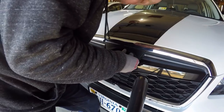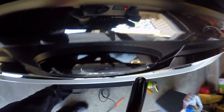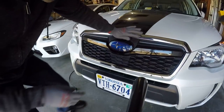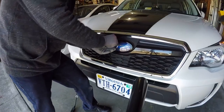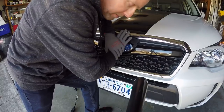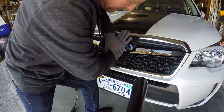Keep some pressure on it and let that tape set a little bit. As I mentioned on the rear one, you will have a little bit of gap compared to a bone-stock Subaru, but nobody but you is going to notice that — it's just because of the extra tape to really get it to stick well. Apply pressure for about 10 seconds in each spot to make sure your tape melts together a little bit and gets nice and solid.